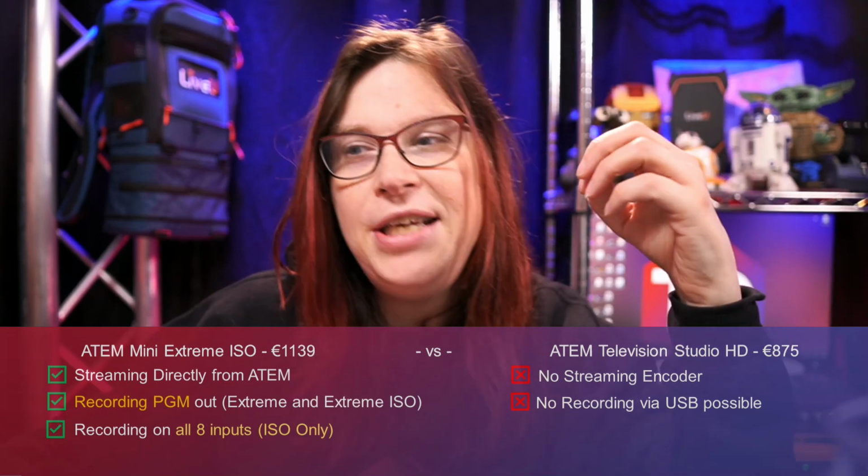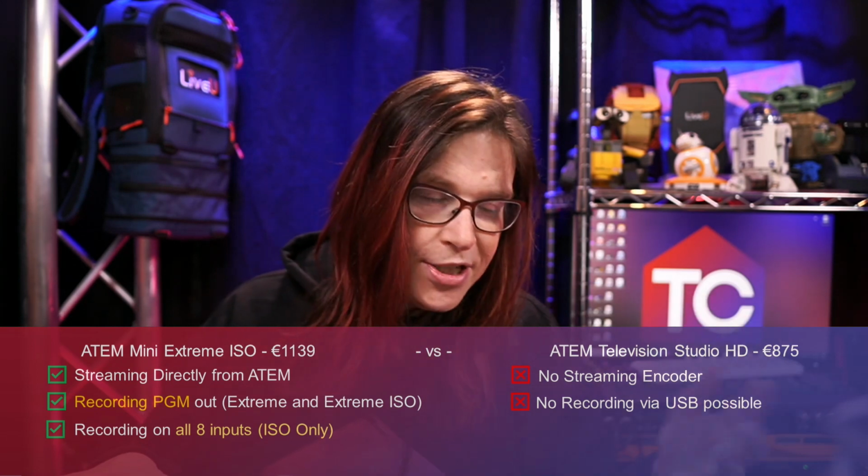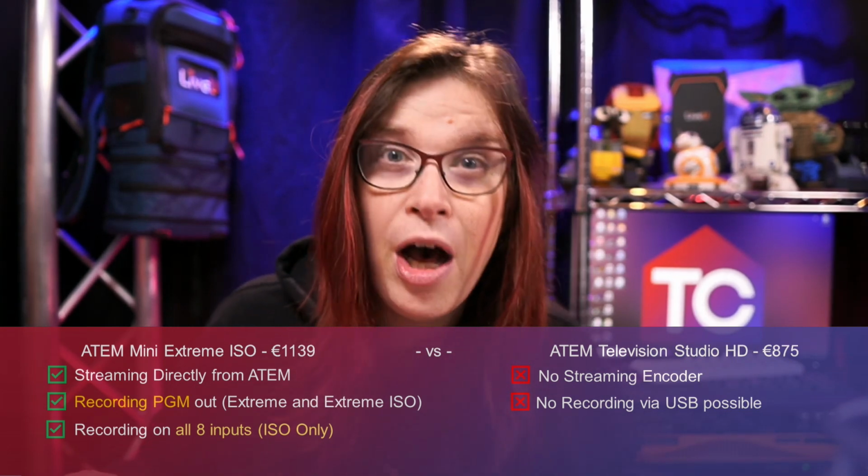Now, last but not least, let's talk about streaming. The ATEM Extreme streams directly from the device itself. All you have to do is pre-fill the stream key of Facebook, YouTube, Twitch, Restream IO, or even if you have the ATEM streaming bridge, which I have and we will have a video on, you can just click the on air button and it will automatically stream without any computer, as long as you have pre-entered the stream key. That is the only thing that you need the computer for.